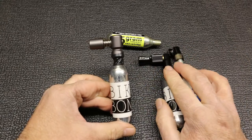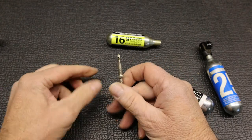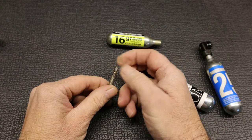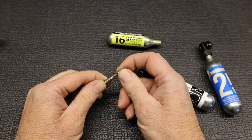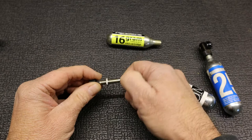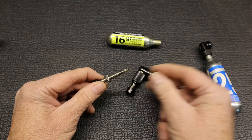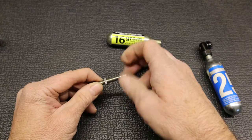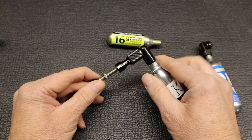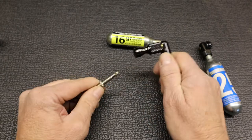I'll quickly show you the difference between Presta and Schrader valves. A Presta valve is normally found on all modern mountain bikes, especially tubeless ones. As you can see, the valve setup has this little turn-out section — when turned out, it allows the valve to go up and down so you can inflate the tire. When you finish, you turn this little part until it gets tight and that seals it against the inside so no air can come out. When you need to inflate with a CO2 canister, first make sure you release this — press once or twice to make sure air comes out — then place the adapter over the Presta valve and press down to fill up the tire.